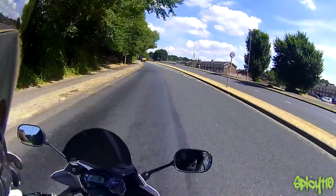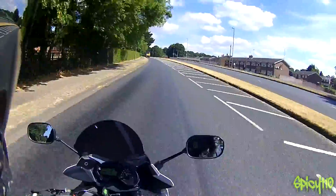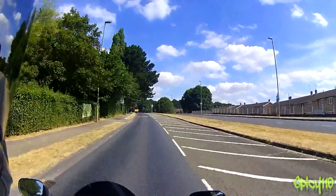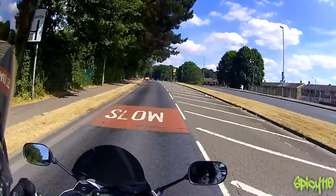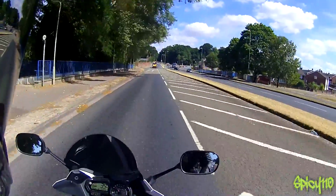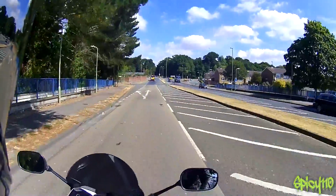Yes, it's probably not the best tyre for that wheel. Whatever, I'm just going to get that out of the way. But it makes it wider, so it's harder to get out, so you have to take the chain guard off. It's also a pain in the arse for the DRZ because you have to somehow get the rear caliper up and out at the same time you're holding the wheel up in the air, which is the same time that you're pulling the axle out.